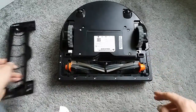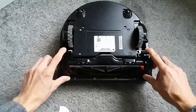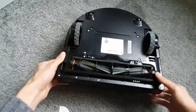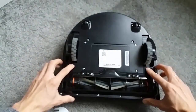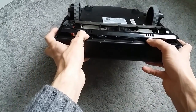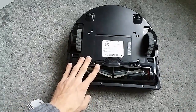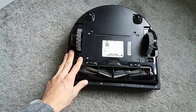Once the brush is in and spinning nicely, take the brush guard and put it against the latches, then drop it down and lock the left and right side - you should hear a small click. Make sure that when you look at the line, the brush guard is fully in, because sometimes one of the latching systems isn't fully engaged. It's better to start from one side first and then push it in until it's locked. Okay guys, that will be it - thanks for watching! Please subscribe to my channel and if you have any questions post them down below. Take care, bye!